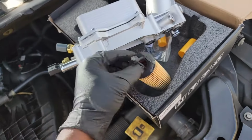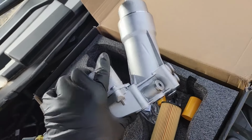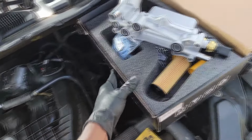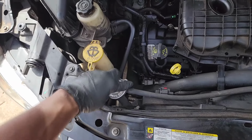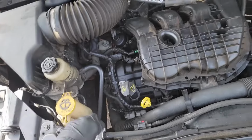So because I got an oil filter right here, I'm assuming there's no oil filter in here. So I got to take that off and check that. And guys, I'm outside on the ground, as you can see. So y'all know I'm a firm believer in changing oil on these things after this job is done. Simply because there's a chance that I'm going to mix coolant. Some coolant is going to get mixed with the oil when I lift up off that cooler.